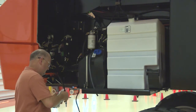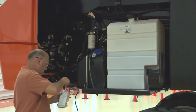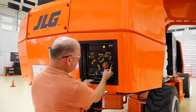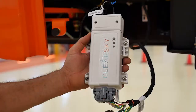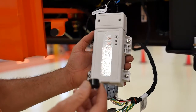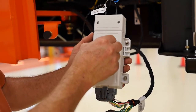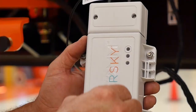Note: it is recommended that initialization of the TCU module be performed before the unit is mounted in place. Start the engine and allow it to idle. The TCU module is shipped in a pre-installation state with modems off. To initialize, hold a magnet over the specified area for approximately 5 to 10 seconds until all three LED indicators are lit or flashing. The red LED indicator will flash slowly while the magnet is held in the initialization position until the initialization is completed and all indicators are lit.